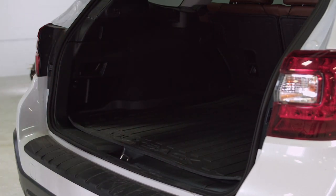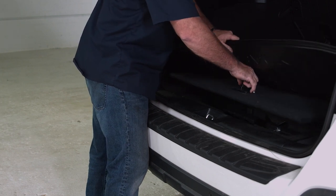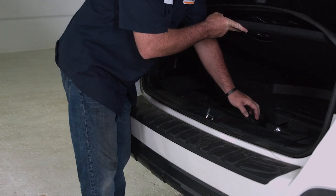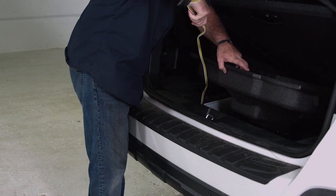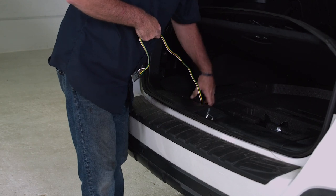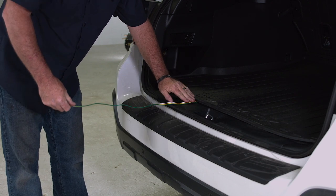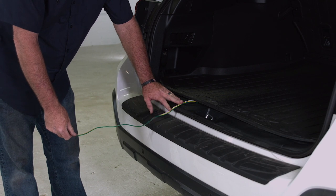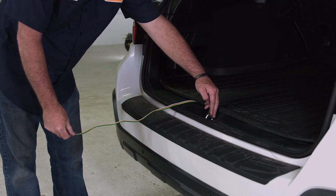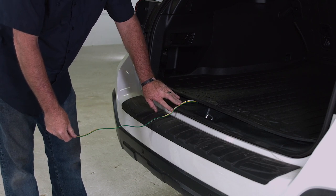That's it for our four flat wiring harness on this Subaru Outback. When you're ready to use your four flat tow harness, just lift up the floor mat, lift up the center paneling, remove the storage jack, and pull out the wiring harness — then it all goes back together. We're going to let the harness hang over the door seal. You don't want it over the door latch because that will crush the wire harness, but it's perfectly okay over the door seal.